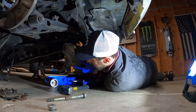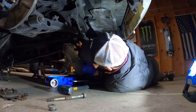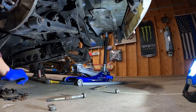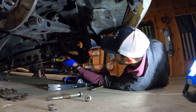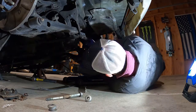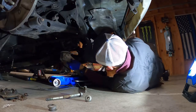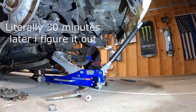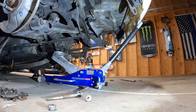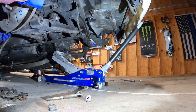On most cars, this brace is going to be attached in the front by the transmission. Unfortunately I don't have anything holding this brace right now, so as soon as I let this thing go, it's going to go. I got the brace completely disconnected. The only thing on this differential now is the axles, which I'm probably going to have to pry off. You just remove this entire assembly right here and the axles just come right out. Once this axle comes out, that diff is probably just going to fall.